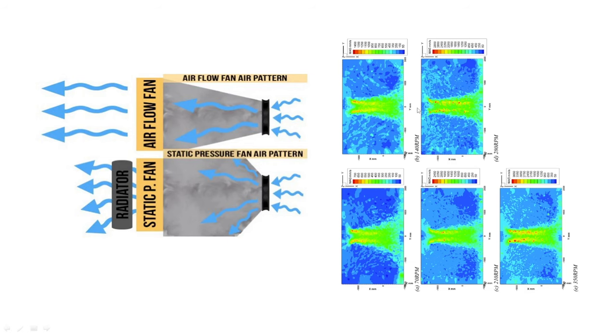Now, what I was referring to before with airspeed entering the fan. Let's say you've got your heatsink or radiator over here, radiator or heatsink for your air cooler. When a fan works, it works by sucking air in, so it's pulling a minor vacuum in front of it to then accelerate air at the front or the back of it. So if you have a fan over here and you're blowing air at the cooling fan, you're pushing air into where the cooling fan is creating its vacuum, thus eliminating or greatly reducing the vacuum because it's supplying it more air, allowing your heatsink fan to operate more efficiently, which is why you see variances in different case designs or fan models as to how effectively they are cooling your CPU temperatures.